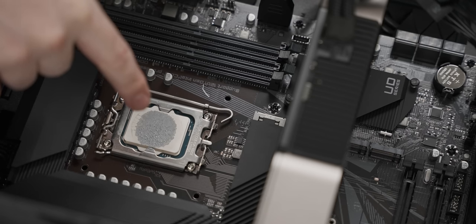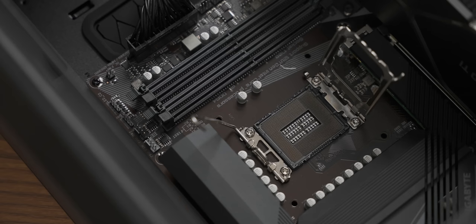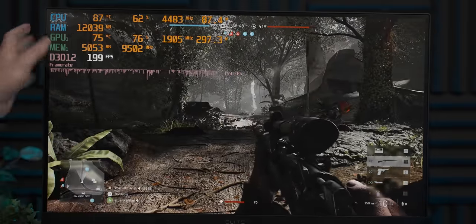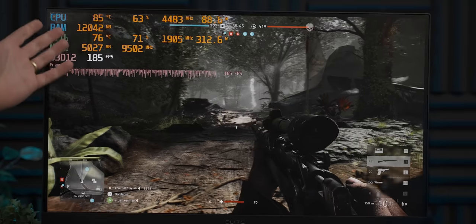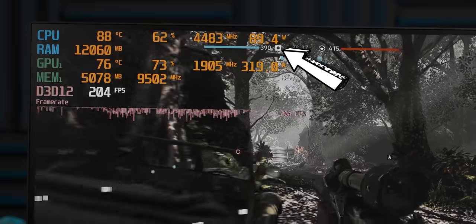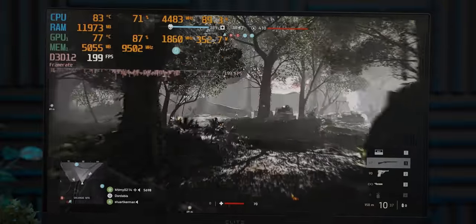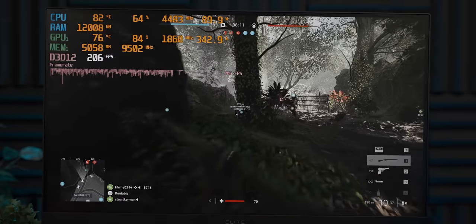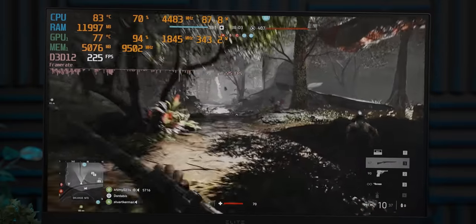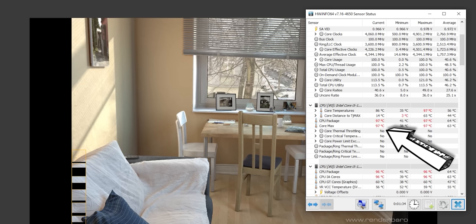That's not a very convincing contact patch. We're going to remove the 12400F and replace it with the 12600K. Playing Battlefield 5 for a while, I figured out that if you set the max frame rate to the monitor's refresh rate you can actually get above 200 FPS at 1080p. This is with the 12600K drawing about 90 watts of power, and we're jumping around in the 80s Celsius — so it's getting hotter, quite noisy, and it's struggling. The 12600K is not running that fast and we're still getting quite high temperatures, so this is definitely not a good pairing, especially noise-wise. But when moving over to Cinebench, the temperatures quickly sprinted to 100 degrees Celsius.